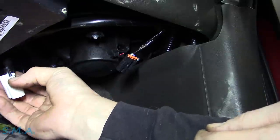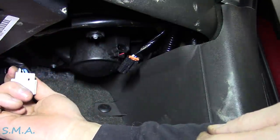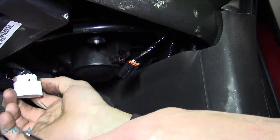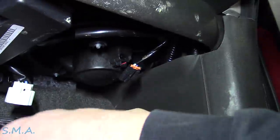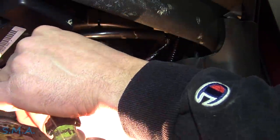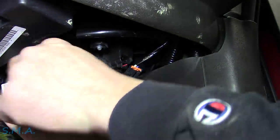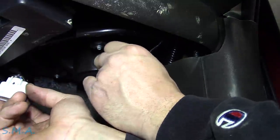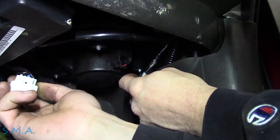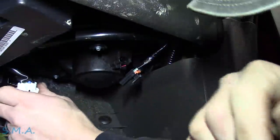What's interesting is we've got power — that looks like a power, probably the same color as what's at the motor. Black is probably the ground. This looks like one of them fancier computer-controlled ones. We've got power and ground: white with a green stripe is the power, the black is the ground. The blue, I assume, is the same one that comes out to here. And then we've got a small light-green wire — that's probably a duty cycle control from the head unit.